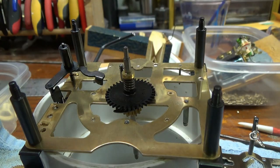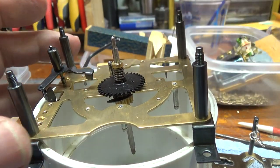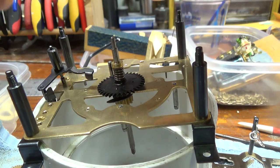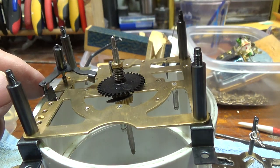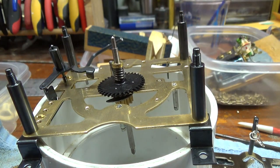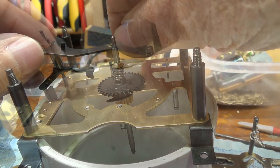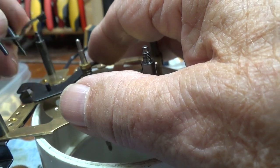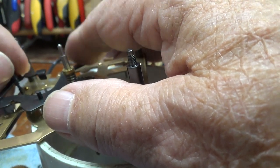You know what opens this? Are these little tabs. That little tab is going to rotate this way. It's going to lift up on this. And that's going to push that flag in. And then what keeps the door open is this lever, which goes in here. Anyway, this drops down and catches that pin that's on here. This pin is caught by that hook. And that's what keeps the door open.